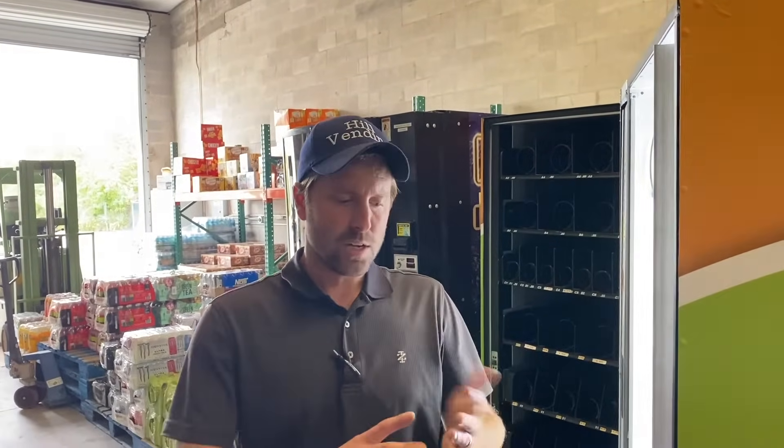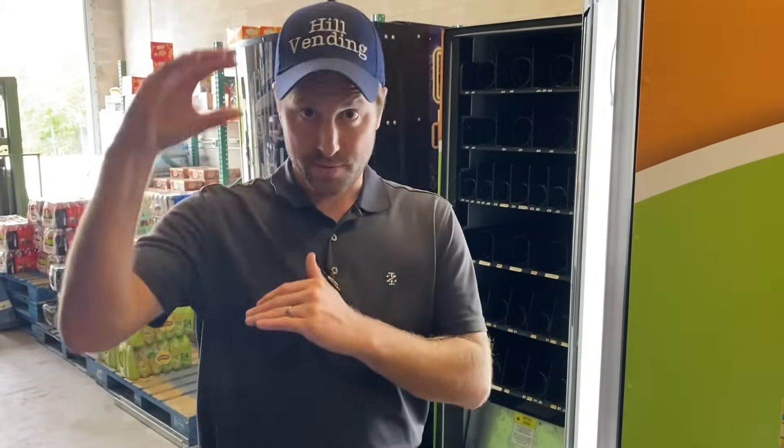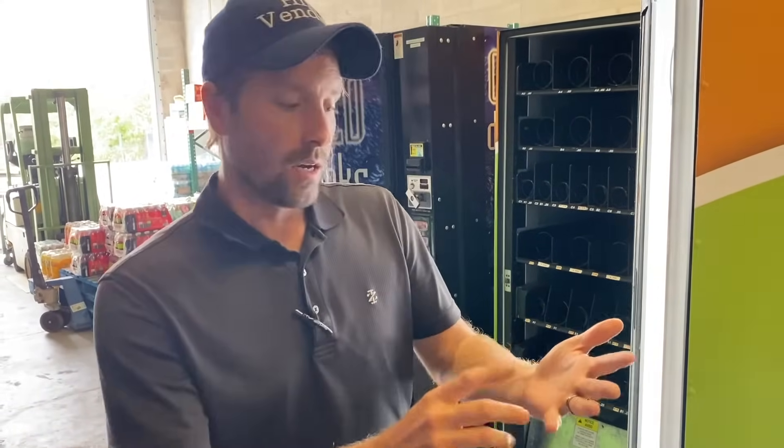Let's talk about when people buy stuff out of the machine. If you put in a $1, $5, $10, or $20, what can the machine take? Depending on your bill validator, you can take ones, fives, tens, all the way up to $20 bills. The problem with taking $20s is your bill acceptor has to be upgraded and it's going to give out a ton of change, which drains your coin mech. Then you have an exact change issue — two people put in two $20s and you drain your coin mech. We at Hill Vending like to keep it at ones and fives, and if they have a credit card reader they'll use that for anything past a one or a five. When it gives change, you can have it give quarters, dimes, and nickels, or you can have a coin mech that gives out dollar coins for higher denominations.